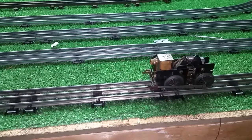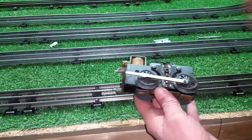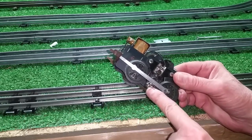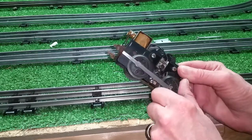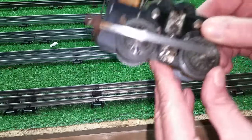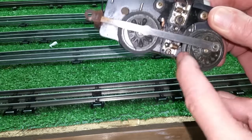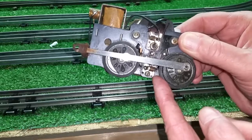As soon as I took this out of the box, I had it on the bench and stuck a screwdriver in there just to ground it — it took off running. So all you've got to do is make sure, if you have a truly dead motor that's buzzing, make sure that screw is tight. Make sure these two screws are tight. Make sure your springs are in position. And in particular, make sure this spring is actually resting on that platform. Many times the leg of the spring will be over here and it's not making a good connection — you pop it back into position and bang, the motor takes off running.